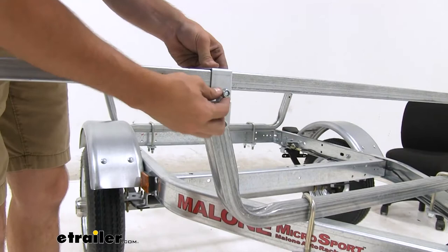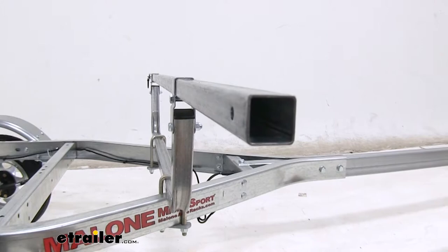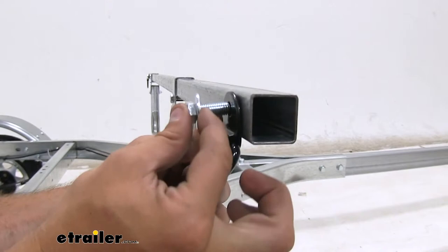On both your crossbars, be sure that the one hole on the outside of each side of the bar is facing towards the inside of the trailer. A final step is gonna be to get our D-rings installed in those holes. We're just gonna apply a flat washer and then put the bolt through there.